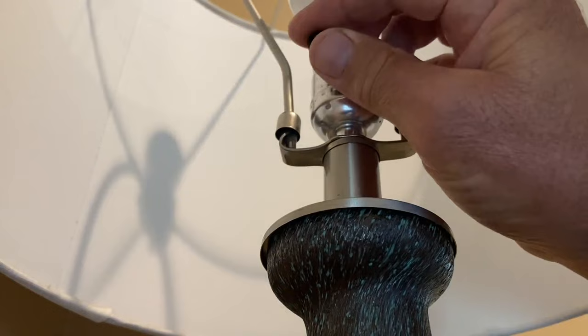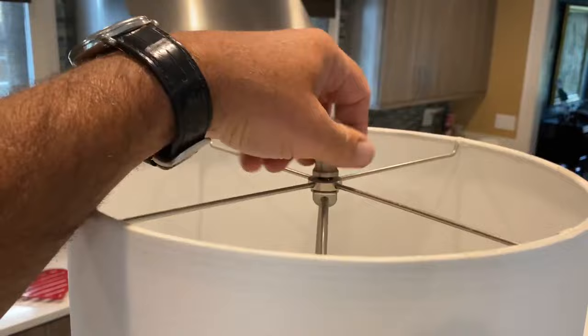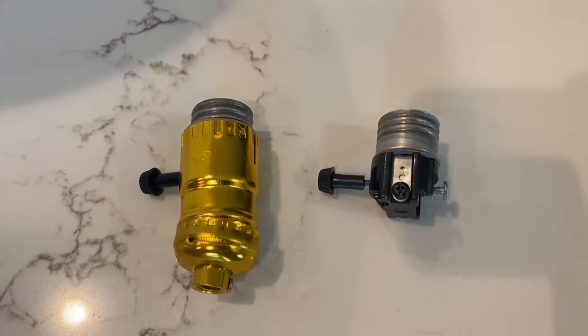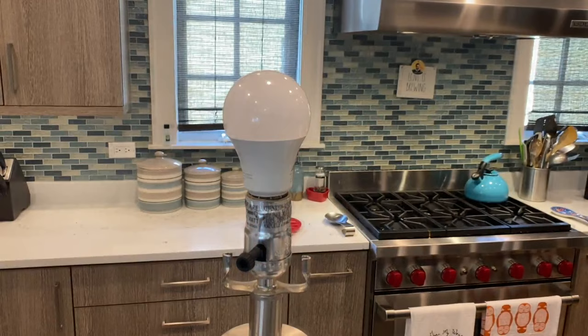Changing what I call the guts of the lamp is super easy to do. The first thing you're going to do, obviously, is unplug the lamp because we don't want to do this when it's live electrical. That part — the outlet portion — we're going to actually replace. You're going to take the lamp apart, take the shade off. That thing that holds the lamp shade over the top is actually called the harp. In order to access the lamp, you're going to take that apart. You have two ways to do this: there's a full socket on the left, or the guts of it on the right — we're going to change that out. Take that harp off, and unscrew the light bulb. Remember, this is unplugged.